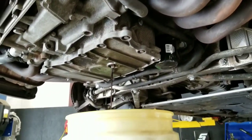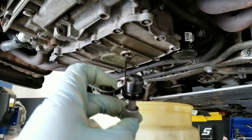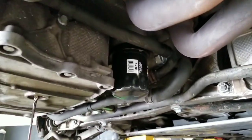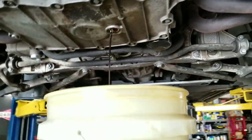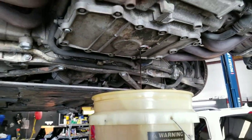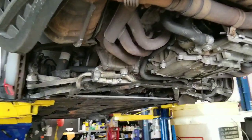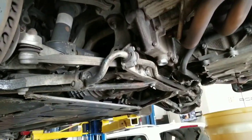This is a very good test to do when you're draining the oil to check to see if there's any kind of weird, abnormal material. We'll also check the filters — these will get cut open and we'll make sure there's no gold material or anything in there for rod bearing issues. Because these can actually suffer from that, especially if they're tracked or abused.